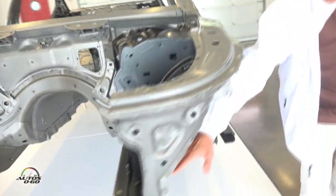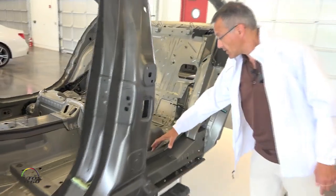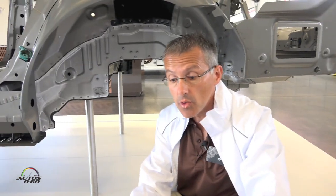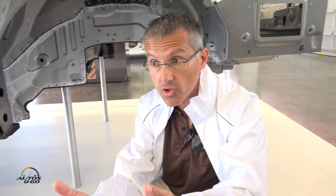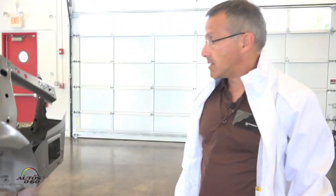Other parts I would like to explain are the aluminium parts: the shock tower I mentioned before, the aluminium extrusion, and now another large aluminium part — from here to the end — which is 1.30 meters long, one of the longest in the automotive branch. This part is the structural connection for the chassis, and it gives us the chance to fulfill the stiffness requirements. This also gives our chassis development colleagues the possibility to realize a suspension that is both comfortable and sporty.